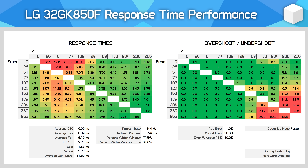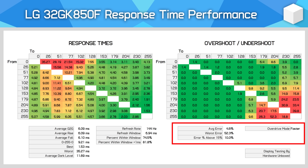So ideally, if you're looking at these two graphs on screen right now, you'd want pretty much everything on the left to be green and pretty much everything on the right to be green as well. That would be the ideal case, but as you increase the speed and get more green on the left, typically that means you're going to get more red on the right. So it's a lot of a balancing act with these sort of displays, and this will give you much clearer information as to where the balance lies with all the different overdrive modes in a monitor. The color threshold for error on the right is 15% — that's where I've found I can start to notice the artifacts of inverse ghosting. Below the table, we have the average error and worst error recorded — fairly self-explanatory.